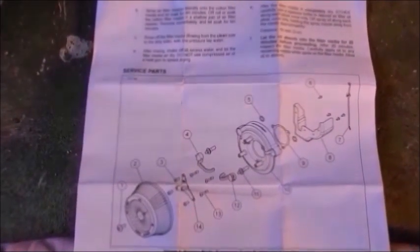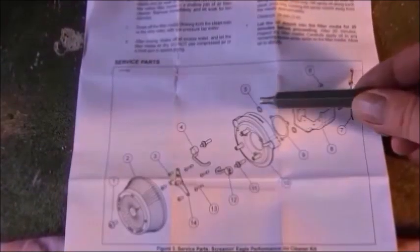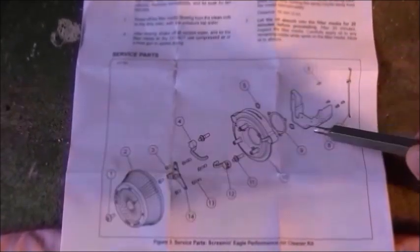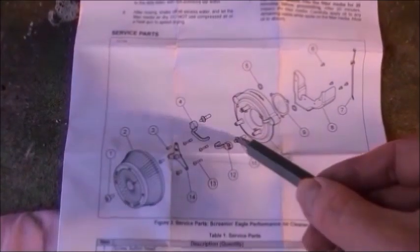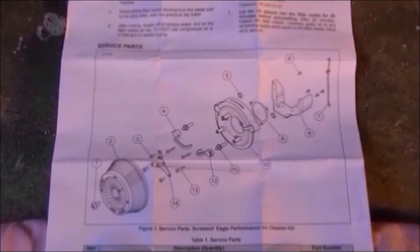I looked at it on the diagram, you can see what I was talking about that you just missed. This is the main back plate, and at number five there are two rubber washers, and they go on to a little indented bit on the rear of where the breather pipes go. Put that against it, and then the breather pipes go in through the front of the holes, all put on with blue Loctite, of course.